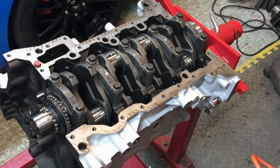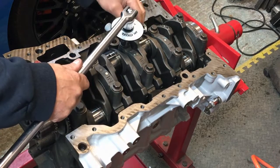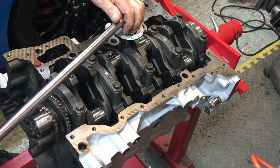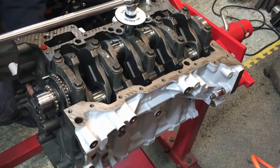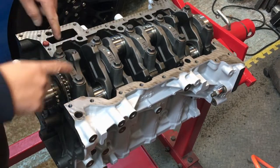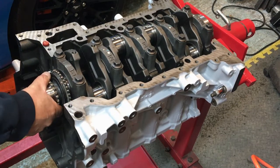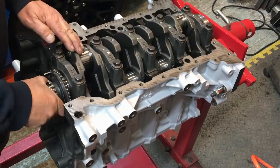That's torqued down. Now going to 105 degrees — always a problem because the engine wants to roll around. I ended up going 60 degrees just to make sure they're all down. When the new bolts arrive I'll undo one at a time and replace each bolt properly. Moment of truth — turning the crank — and yes, it turns beautifully. Quite a bit of friction from the sticky assembly lube, but all free rotating with no tight spots.